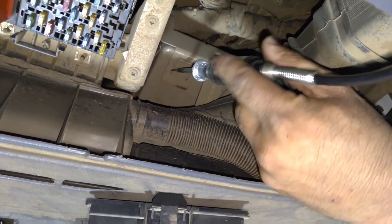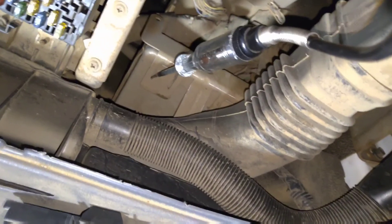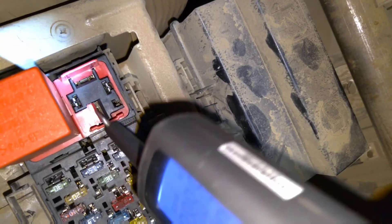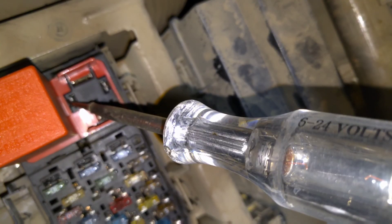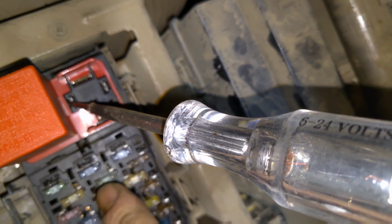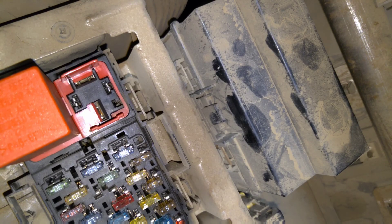Let's verify our earth supply is working. Touching earth on the ECU body and putting power on the test light - it lights up. But we thought this pin had earth for the relay - on the probe you can see the green light showing earth. But when I actually put the probe in there to verify the earth, it's not lighting up. So that means it's got a bad earth coming into that pin on the relay. That's why our relay is not working, that's why we don't have power on that fuse, and the result is there's no blower fan.